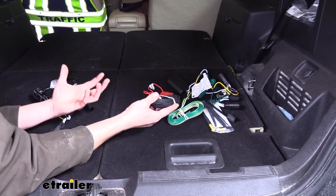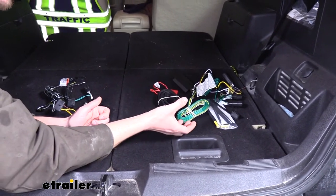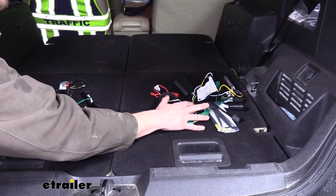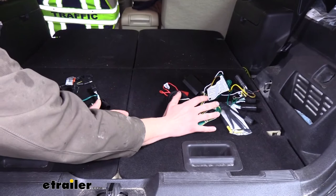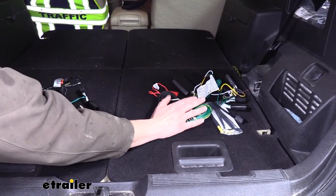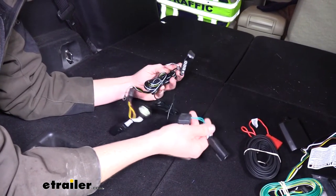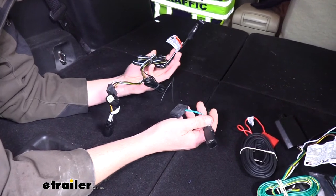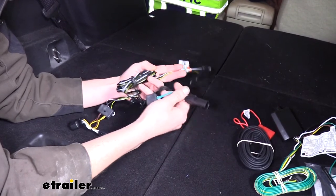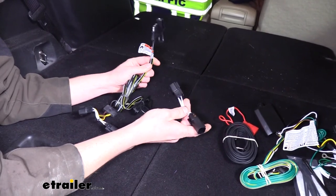You really need to take your trailer into consideration when purchasing a harness for your Flex. If you've got more than just your stop, turn, and tail lights on the back — just one on each side — then I would highly recommend you go with the Curt so you don't have any issues going down the road. Especially if you're planning on upgrading to a bigger, nicer trailer in the future, you want to future-proof yourself with the Curt. However, if you have a small trailer with just your stop, turn, and tail lights on the back, the Tekonsha could be a great option because you can get it installed real quick. If you don't have any plans on getting anything bigger and just want to use that trailer legally around town, this is a nice quick option.